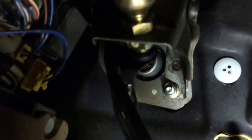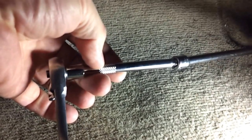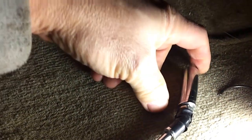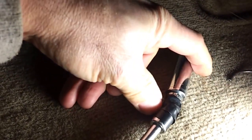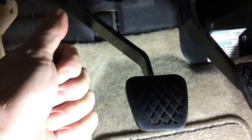There are two nuts holding this clutch master cylinder in — they're 12 millimeter. I'm going to use a quarter-inch drive with some extensions: a four or six inch ball head, a six inch straight, and a swivel. I put some electrical tape around the swivel so that when it bends, it stays in position. Otherwise the socket flops around and you don't have good control. This is a 12 millimeter deep quarter-inch drive socket. I'll get those two bolts out, get the cotter pin out, get the other pin out, and we'll get to the next fun part of the job.